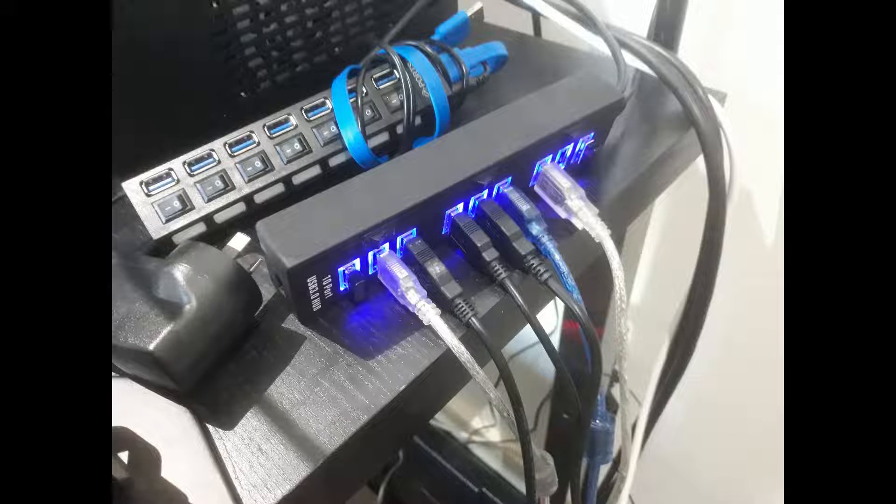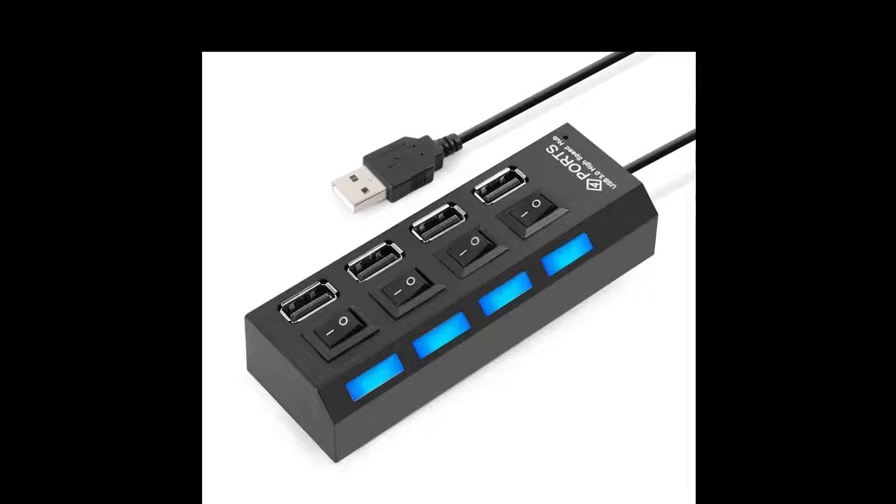To make matters worse, each USB 3 port has a limit of just 16 endpoints. This means that if you have a USB hub plugged into a USB 3 port you're going to be limited straight away. On the other hand, USB 2 devices can have up to 32 endpoints — double that of USB 3. So one way to reduce the possibility of getting the error is to make sure you plug your USB 2 hub into a USB 2 port. If you're still hitting the endpoint limit, unplug some devices from your hub and plug them directly into your motherboard.